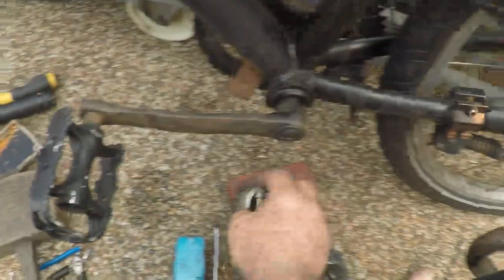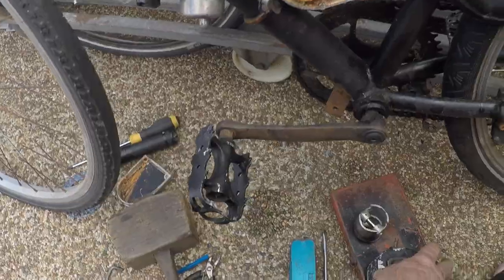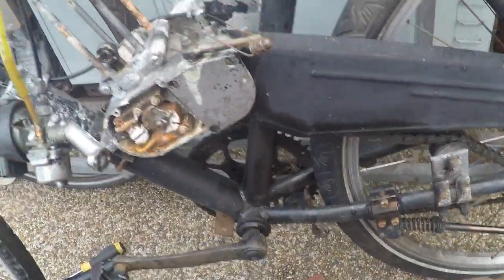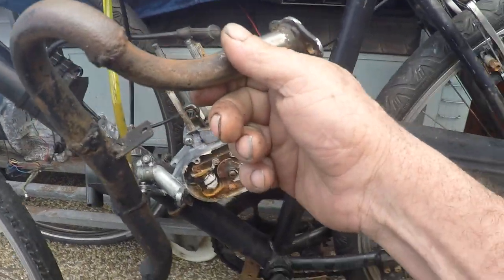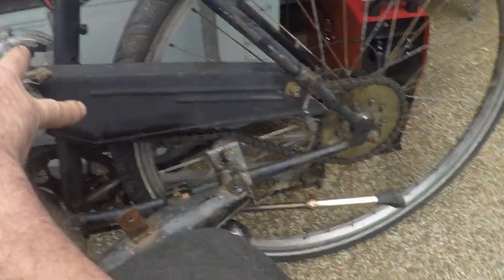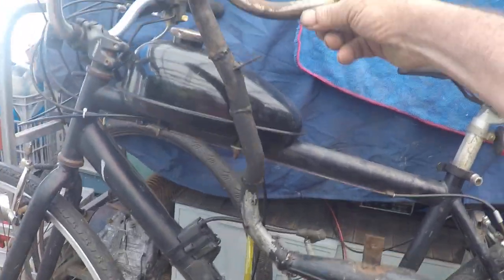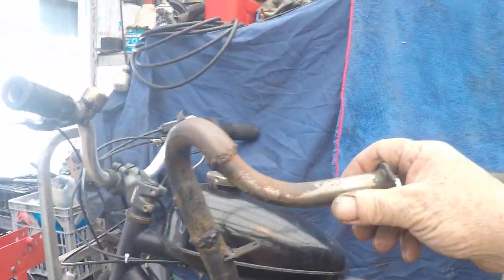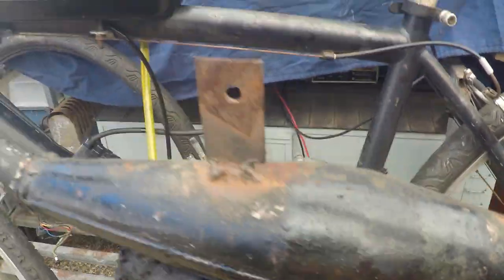And the piston, you can see the marks, I'm only just wearing my rings in. This still has hone marks. I run 25:1 oil, and I was a state champion at two stroke. So I build my own bikes and race my own parts. That pipe is actually a tuned 34-inch from the mean to the face of the cylinder, which is down here, just down in that bit of the pipe, halfway roughly is the mean.